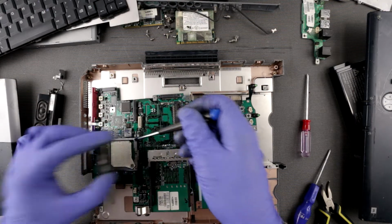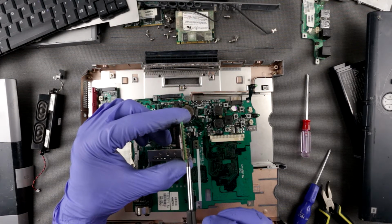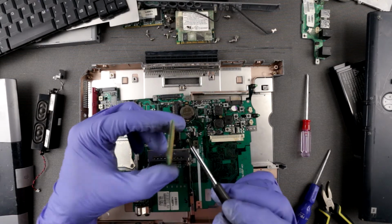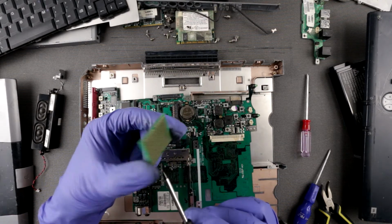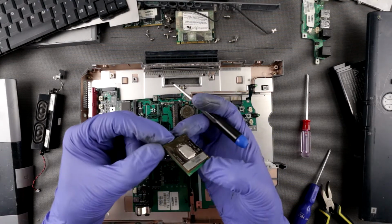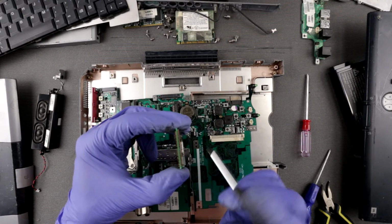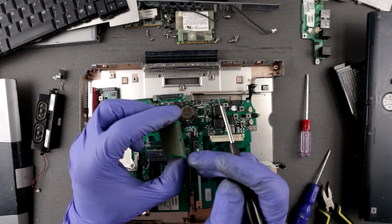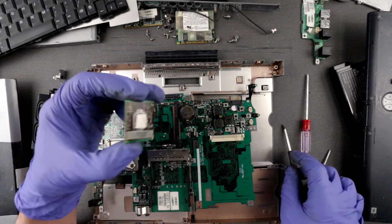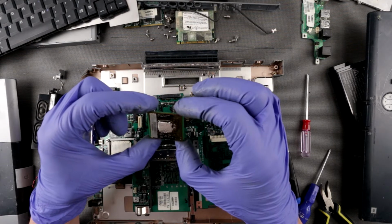Wow. Looks like what's down here is this BGA processor. I don't know if you see that. It's actually soldered to this PCB, and this PCB has this pinout. That's my kind of thing. Am I correct? Yeah, it is. You see? Hope you see that little. So those are a bunch of BGA balls over here, and these are pins. Wow, that's neat. Never seen this before, actually. This is really cool. And I bet you bottom dollar this is a Pentium 3 mobile processor,